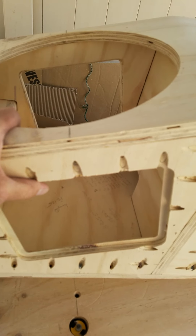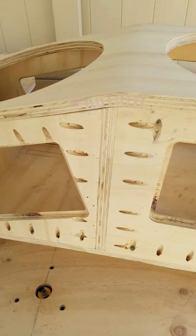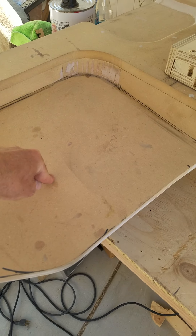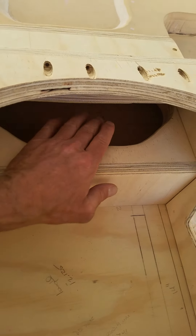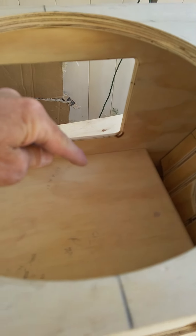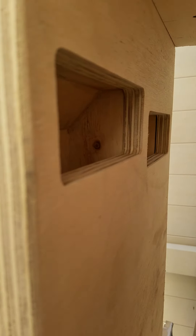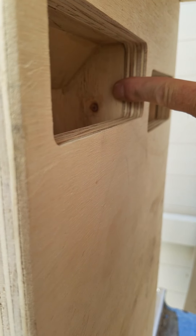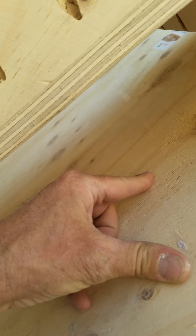Back here in the second enclosure, not much vibration. You might look at it and think, 'Why did you make an amp rack and a box all together?' — but this is actually volume: fiberglass tubs built as a whole piece on top. You can see the entrance down into there. This box volume is two cubic feet and this box volume is two cubic feet. You can see the port for this sub and the port for that sub, and they both exit underneath the bottom between the two seats — about three inches of clearance.